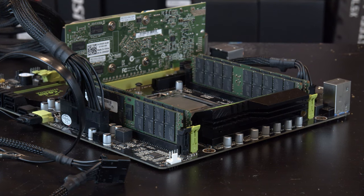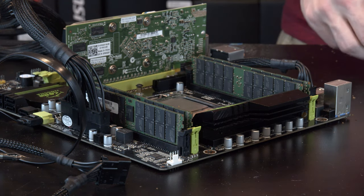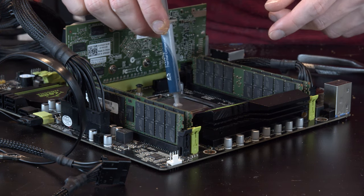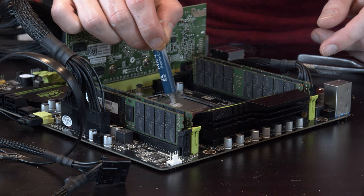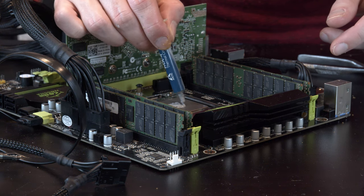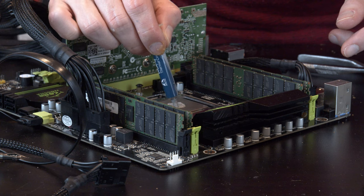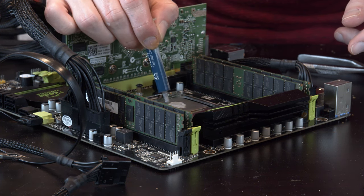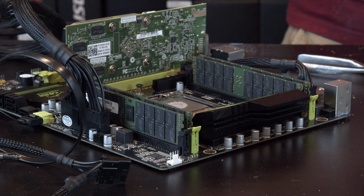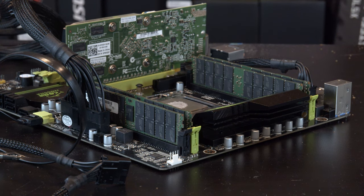So our cooking apparatus looks pretty much what you would expect. Got a little thermal paste on here. Let's take our thermal paste and put that on the processor because we're going to need some thermal conductivity. Now unlike most videos, I would actually recommend spreading out thermal paste manually, because we're not applying a heat sink so there is not going to be enough pressure to push the thermal paste out. Therefore we should spread it out a bit more to get as much thermal conductivity as possible. I know that looks horrible and I know there's going to be a million comments about thermal paste application, but this is not typical thermal paste application so leave me be.